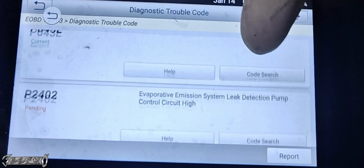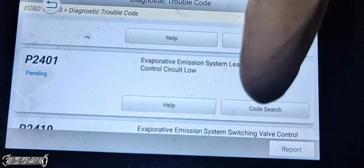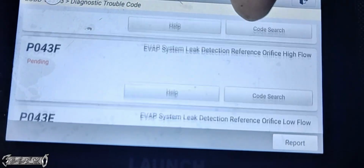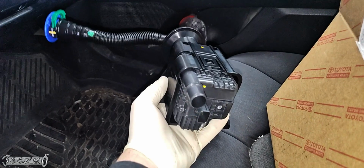I'll put all the codes in the description below. What I've seen on Toyotas, when you get a bunch of codes like this at once, it's usually the leak detection pump. I'll show you what I got right here. This is what I used to fix my problem. It's this guy right here.